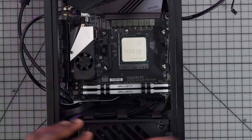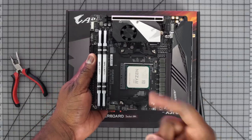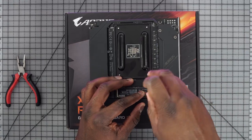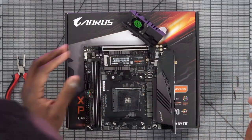The case itself opens up and I drop in my motherboard, but before I do that I put everything I need on it — my CPU, the 3950x, my RAM, and my NVMes. There are two NVMe slots: one at the back at the bottom and one on top which has a cooling fan. My one terabyte goes into the top slot and the two terabyte goes in at the bottom. Then I slot the motherboard into the case — that's four screws.